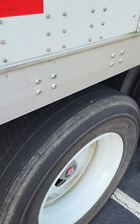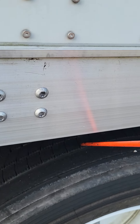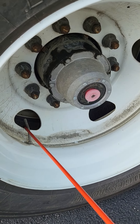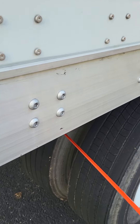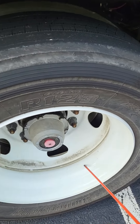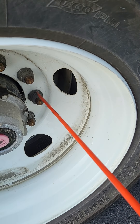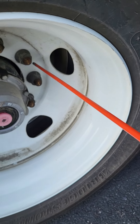Time to work my way out once again to my tire. No uneven wear. No less than 2/32nds tread depth. The side of my tire is not cut, frayed, dry-rotted, or bulging. It is filled to the proper pressure, which is 100 PSI — I'm going to check that with a tire pressure gauge through the valve stem. The valve stem is not bent, broken, or cracked — not missing any nuts, bolts, or screws. Again, these are dual tires, so we're going to check in between — make sure there's no debris and that they're properly spaced. The rim is not bent, broken, or cracked — not missing any nuts, bolts, or screws — no holes or welds other than factory. My lug nuts and studs are not bent, broken, or cracked — not missing any nuts, bolts, or screws. No signs of running rust that would indicate a loose lug nut.